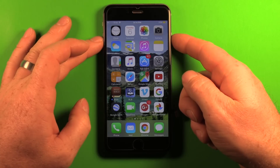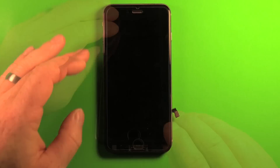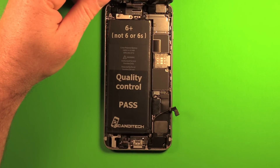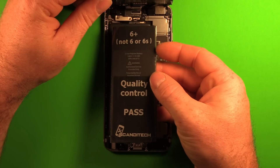Now that we know the battery has enough charge and is going to work, go ahead and power off the phone. Once done testing, gently lift up on the LCD screen again — be careful not to lift it past 90 degrees — then use the plastic spudger tool to pry up under the connector and disconnect the battery.